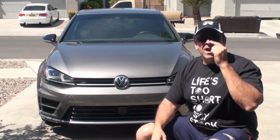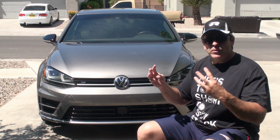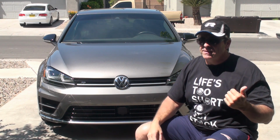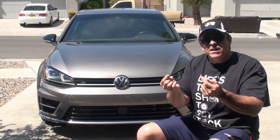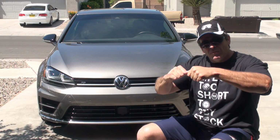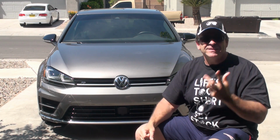The other thing that I don't like with the design here of the front bumper cover is that it has three snap-in points on each side up underneath the fenders. And on my previous Volkswagens, there was usually a track in the front fascia, the front bumper cover would slide in, and then you put one screw in to lock it. But on this car here, there's one screw that holds it, but there's three tabs, and you sort of have to wiggle and pry it out. And there is a tab in there, but I don't know if you can really get to it. I looked at it, I couldn't see how to do it.